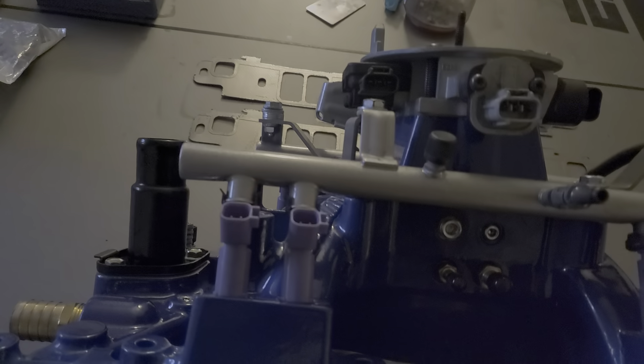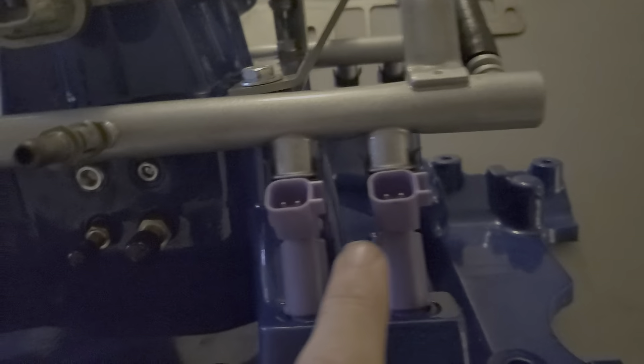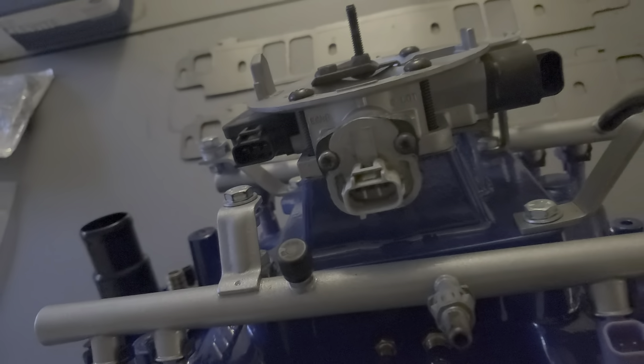For some odd reason, there's one side of this intake where it'll actually stay up — yep, that side. Alright, here are the ports leading up to where you'd normally bolt the carburetor on. This one's been drilled and had these blocks added to it for fuel injection. Here's the adapter plate for the throttle body. Dodge was smart — unlike Chevy with their TBI systems — they actually made it so that their two-barrel throttle body bolts to a two-barrel carburetor bracket.